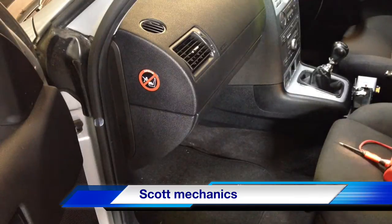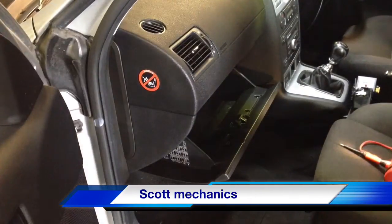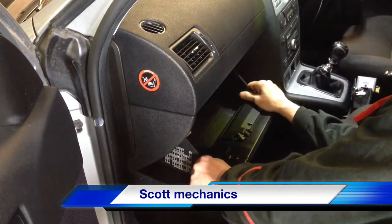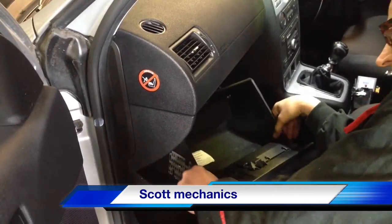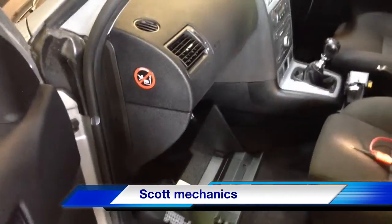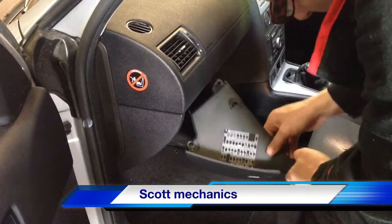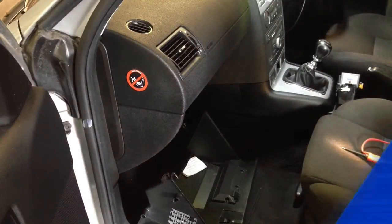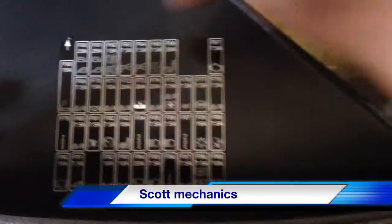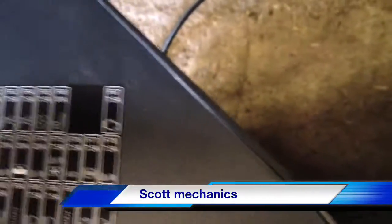Right, this is our fuse box from the glove box. On these ones, put the edges in so it drops down even further, put it towards you, like so. There's a wire at the back, you can leave that on. You can see here there's a picture of a fuse box on the side. Let's zoom into that — we can see it's listing the same one: fuse 68, and it shows a little picture of a cigarette lighter on it. So let's have a look inside and see where it is.